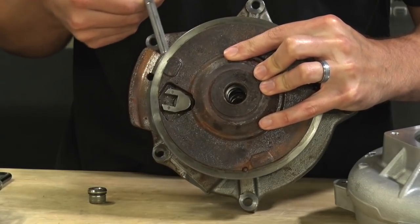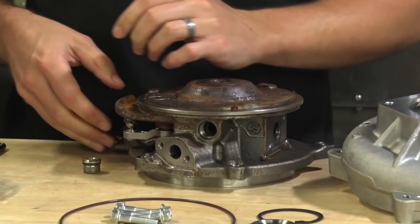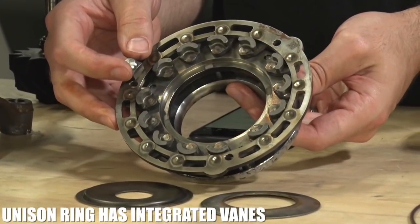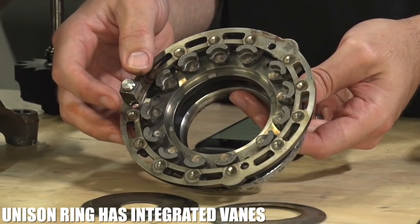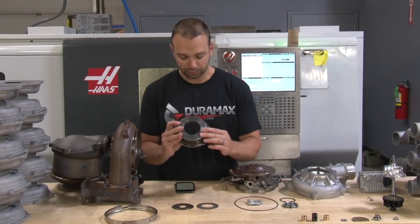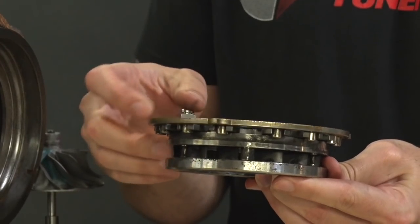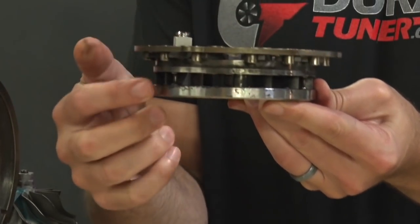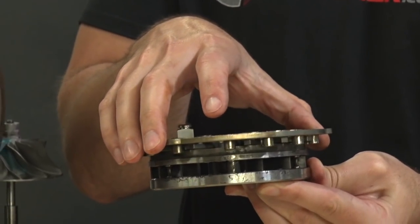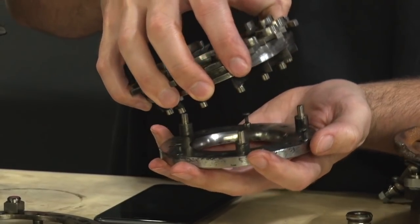You can see how the controller goes through the housing to control that unison ring. Now when we get to this unison ring, this is really the interesting part — the closest we've seen something similar is on the 2.8-liter. On the earlier Duramaxes, the vanes and the unison ring were separate. Now the unison ring is separate but the vanes are integrated in this cage assembly, which is really a nice piece of engineering. But it's going to be tough for us in the aftermarket to improve on it. That 9mm opening distance, and if you look at these vanes, they're quite a bit smaller than on a previous model truck.